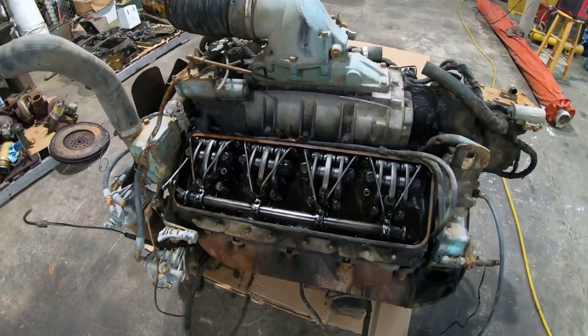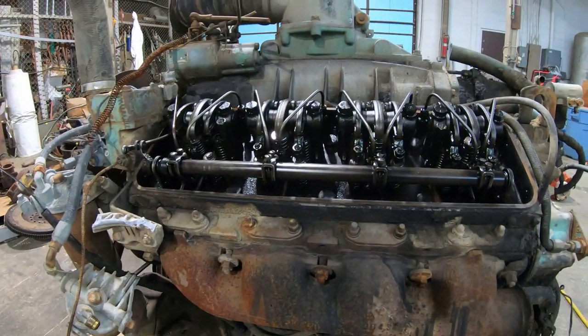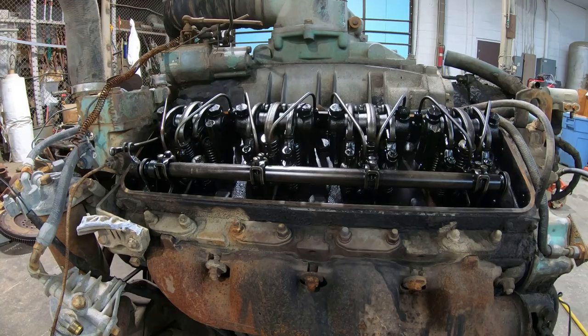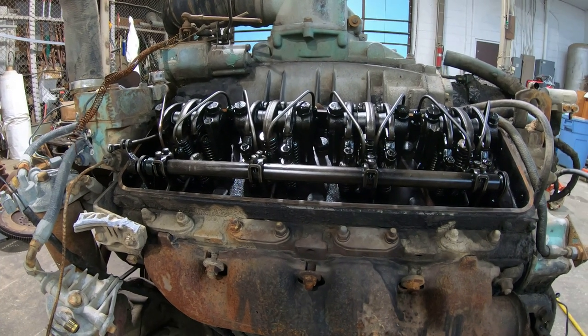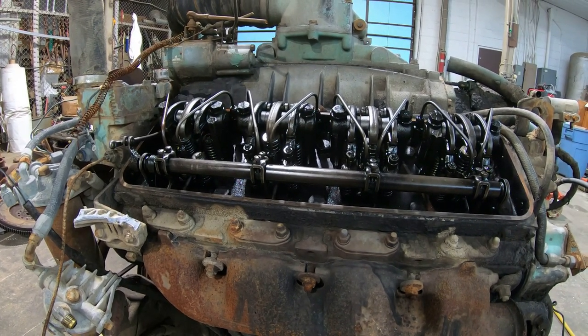The engine's running away. This is a common thing that happens. I mean, obviously not with baling wire, but these engines do run away like that. Anybody that knows anything about two-stroke Detroit diesels knows what a hung rack or stuck injector runaway is.